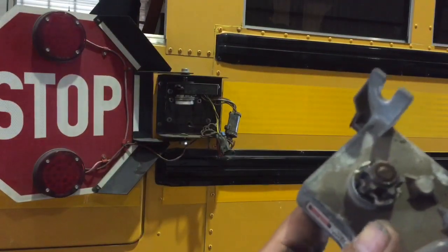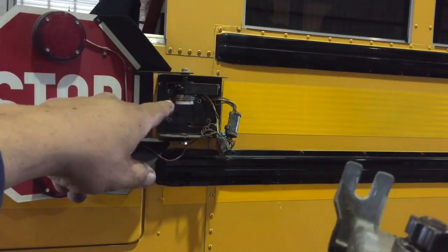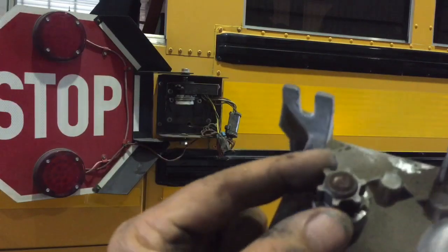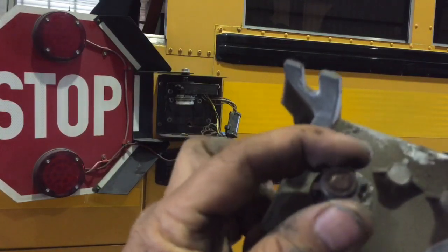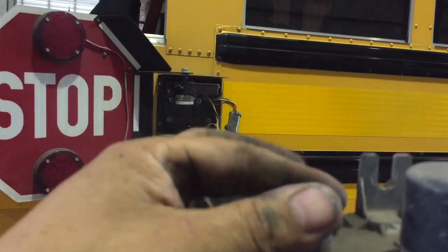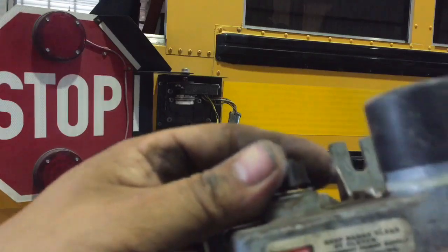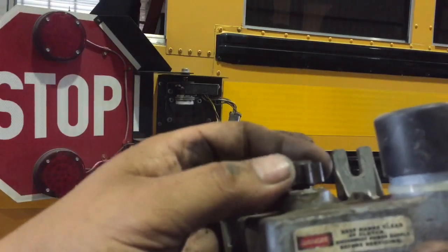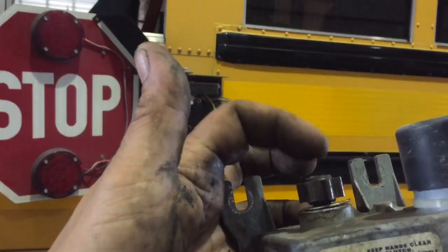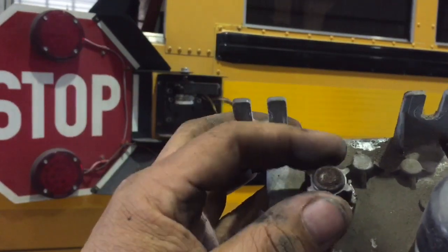As you can see, that little plastic cam is what rotates the stop arm open and closed. It's got a little brass/bronze sprocket embedded in that plastic wheel, and the motor itself turns it. As you can see, this thing is seized — the motor works but this thing is seized. I need to figure out a way to remove this little sprocket off the motor without breaking it.